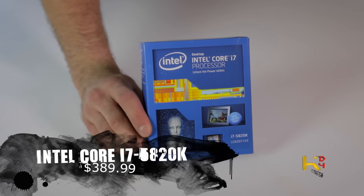Running in this system is the lower-end i7 for the X99 chipset — the LGA 2011 version 3 — which is the i7-5820K. It has 28 PCIe lanes, but the motherboard I chose gives me more. This is only about $300-400, whereas the 5930K is $500 more and the eight-core 5960X is $1,000. I don't need eight cores — this works just as well, and it's a K version so it's overclockable: 3.3GHz base, boosting to 3.6GHz, six cores.